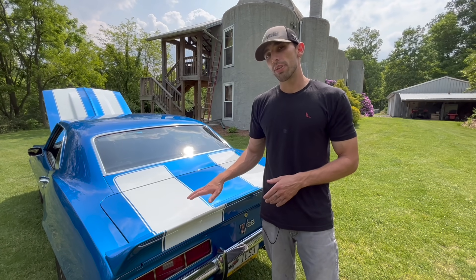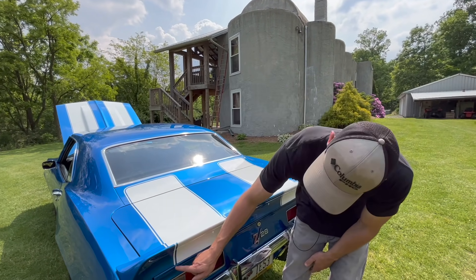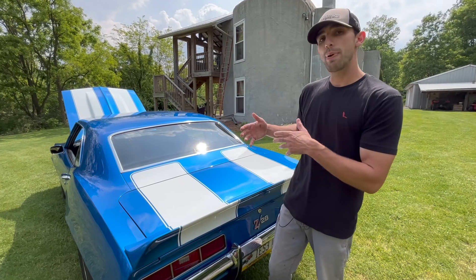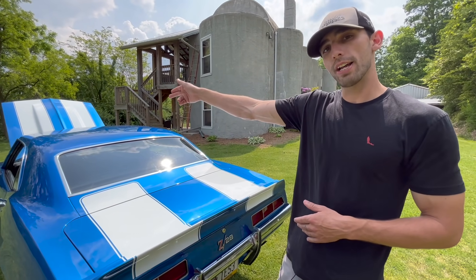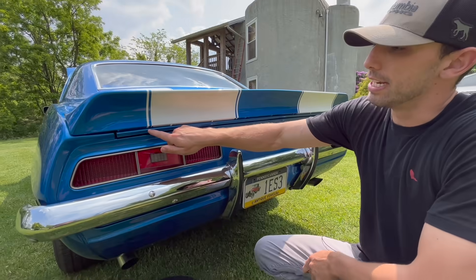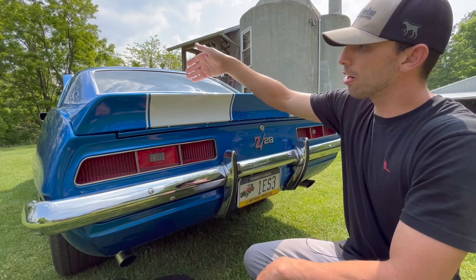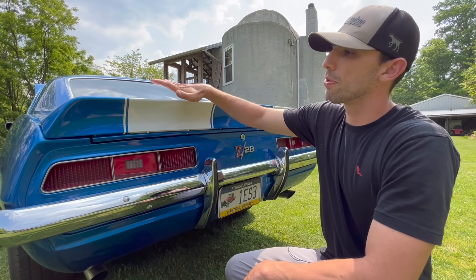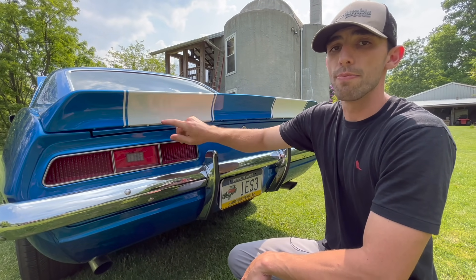Since this car did not come with a rear spoiler from the factory, it originally would have had stripes that came all the way down and onto the trunk lid — no spoiler. However, the spoiler on this car is actually painted correctly for an original factory spoiler. If you had a D80 code and your car was built after April 1969, the trunk lid itself did not have the stripe on it back here, but the spoiler did. This car coming from the factory without a spoiler would have been painted in that section, and then a dealer could have added a spoiler on top.